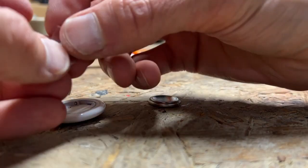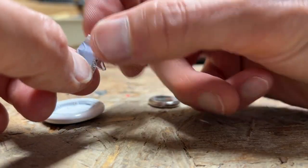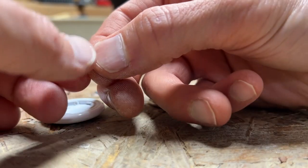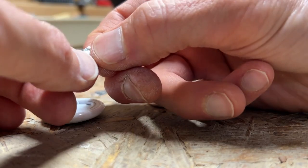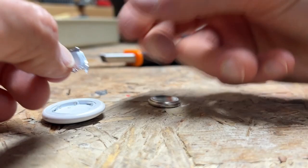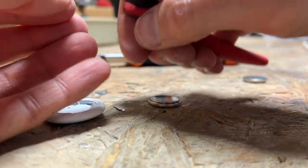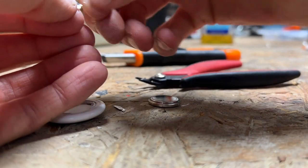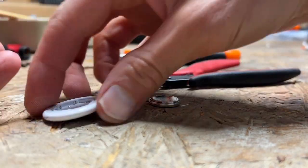Solution: no scratching the battery, no steel wool, no sandpaper. Get a little bit of tinfoil — regular old tinfoil from the kitchen. We're going to make a little tiny piece. You want to be careful, because when we put it in there we don't want to end up making a short between the negative and the positive side. Go ahead and make it into a bit of a point on one side, kind of a small triangle. It doesn't take much, just a little bit of tinfoil.